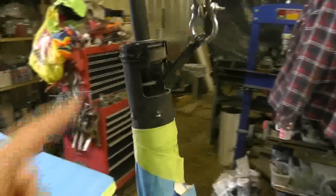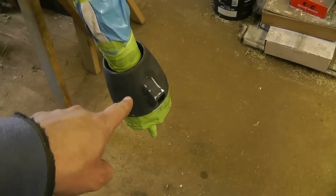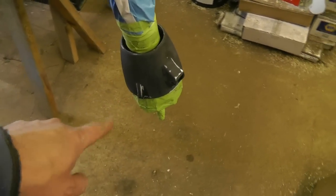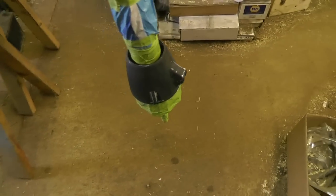I've sanded up here and the shifter bowl with 400 grit and knocked out some of the nicks and scratches. We'll see how that goes.